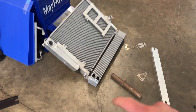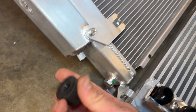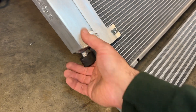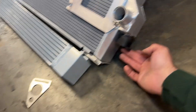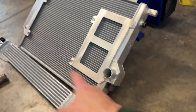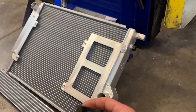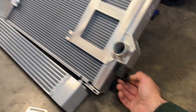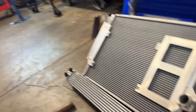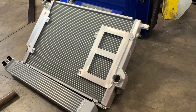As a result, you need to make sure that you have the right mounting accommodations. There's mounting on the bottom here with these rubber grommets — they kind of slip inside and then you hold it in place with a little cradle. Here is the cradle — it literally sits just like that, so you're just resting the radiator on these things. You have two on the bottom and then on the top you're going to hold it together with these guys onto the core support, so it's being held in by four locations. The problem is I need a custom location because there was no E30 spot on the M3 to install it. I need to identify exactly where that's going to be and make a bracket, then get those two brackets installed on each side of the frame rails.